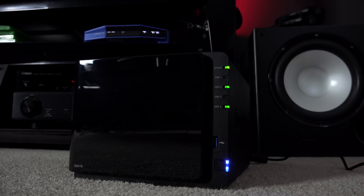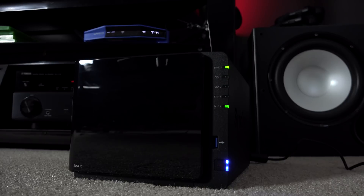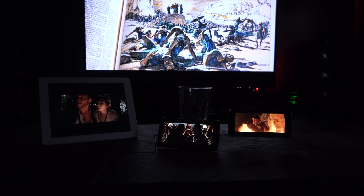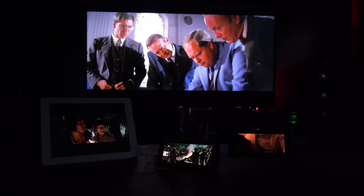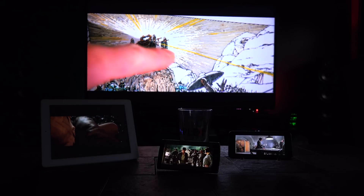In the end, a prebuilt NAS has proven itself to be a viable solution for in-home entertainment. With the correct video formats and bitrates, you can play media on a large number of devices simultaneously without experiencing any stuttering. With enough planning, you can even prepare your server to push media to clients outside your network — you just have to focus on what bitrate matches the situation best. I should also note that almost every client did need to do audio transcoding, but the DS416 was capable of handling those without a problem. I plan on doing more videos surrounding the Synology NAS in everyday usage, and I might even look into a more powerful version to test with the transcoder enabled.